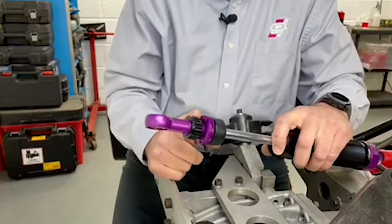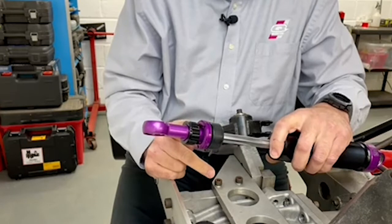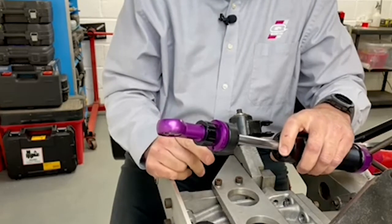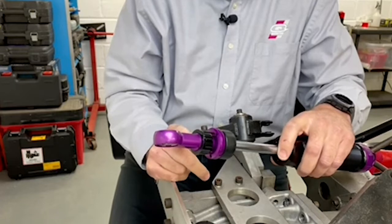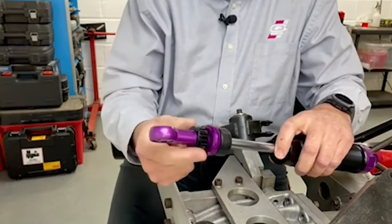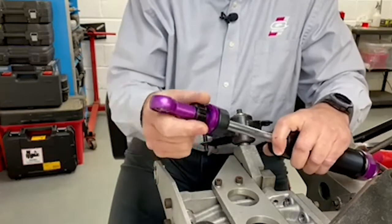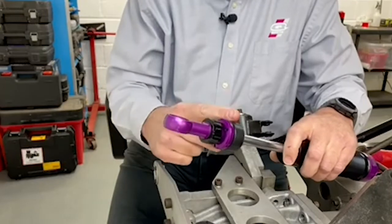Now the range is 24 as I've said, but some of the dampers may have more than 24 clicks — however, there's no point going past 24 as the linearity of the needle is very poor after that and the flow rate change is very small. So just to round up: always make your settings from full stiff, all the way clockwise. Anti-clockwise is softer and the range is 24.